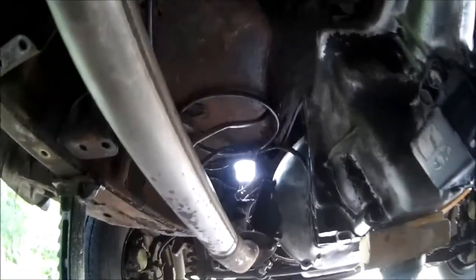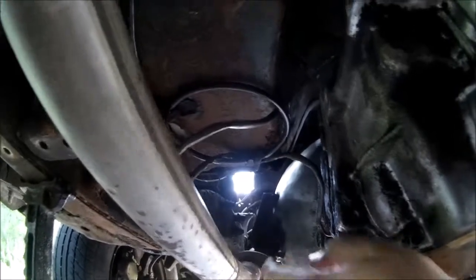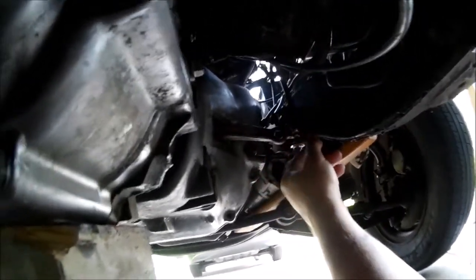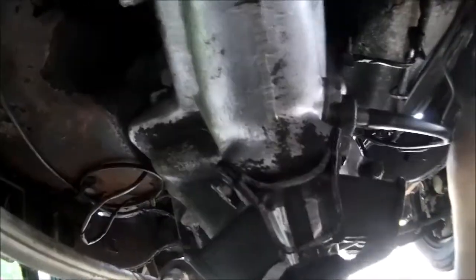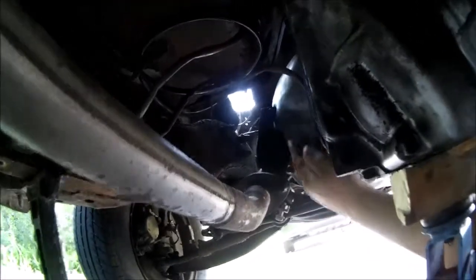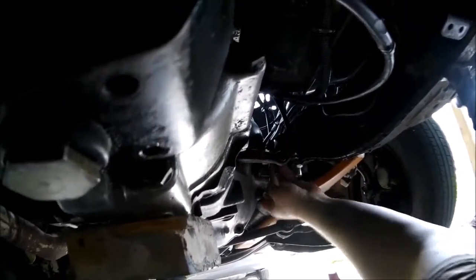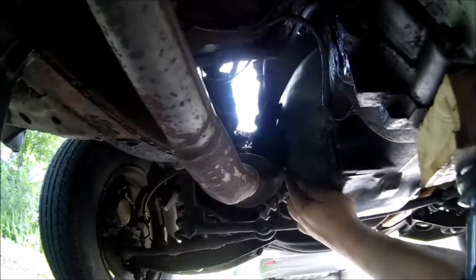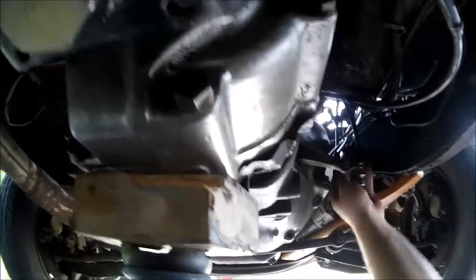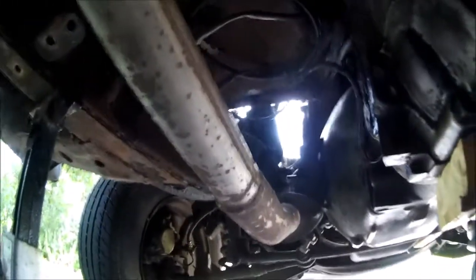I got the 4 17 millimeters in. There's one on that side that holds that plate that holds the pipe clamp. There's one right here behind the clutch fork, and there's two up top. Those are the four big main ones. Everything else is 14 millimeter. There's a 12 on top of that plate, but that doesn't matter. It's 14, and that just holds the stiffener plate. Here's another. Yeah, one, two, three, four. Four 14s that hold the stiffener plate. And that's for the starter bolt from the other side. But basically those 17s are the only thing holding the bell housing to the block.